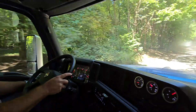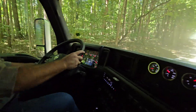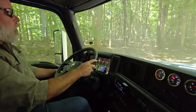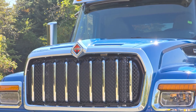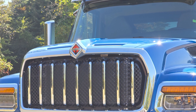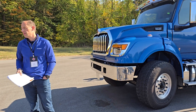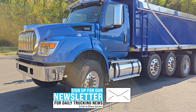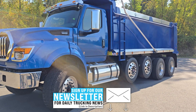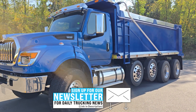The horsepower ratings go from 370 for the 3000 series combination, with 1450 torque, all the way up to 515 and 1850 torque with the T14 transmission. This is a setback variant, so the BA position is 46. When we move into the 515 version, you'll have a BA position of 29.5.